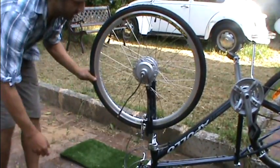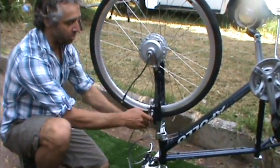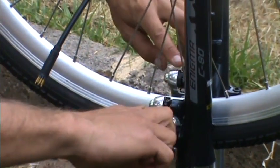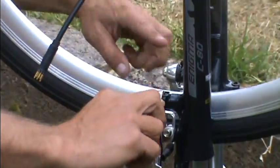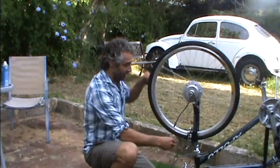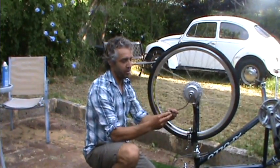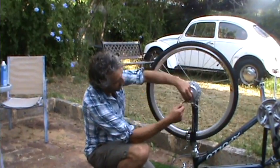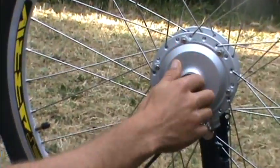The next step is just to adjust the brakes. Typically what you'll have to do is align the brake pads with the rim, have it sitting nicely on the rim. Then you have little screws here — they work as pivots. Just align it with these screws to make sure it's nice and centred, and then you can adjust the brakes. Tighten the brakes, adjust them, it's ready to go. These little caps here are a little bit of a weak point, so it has a spring to protect it and also a plastic cap to protect it.